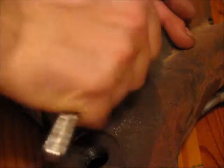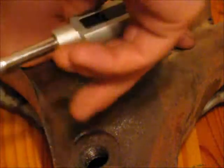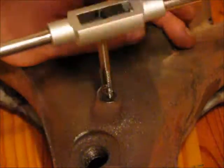Just cast iron, so it's pretty thick. This might take a little while. Just keep working it back and forth and screwing it down in the hole. Now I'm confident that it's giving me too much resistance to go any further, so I know I've hit the end of the hole. Just work it back and forth a little bit. The purpose of this is so as you're cutting, the grooves in the bit will let all of the metal shavings come out.